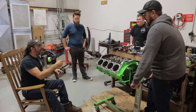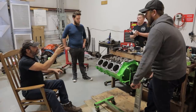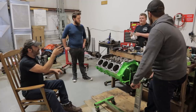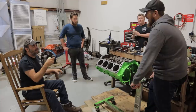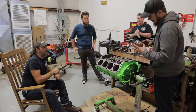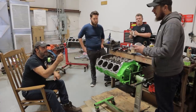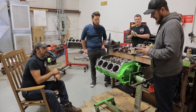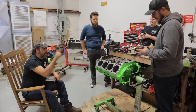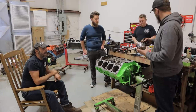We're starting with number one. Now you've already put the rings on the piston. Dot facing up — all markings that indicated up going up. And you're positive that the top ring is in the top ring groove and the second ring in the second groove? Put my life on it. And we did all of them and pre-set them.